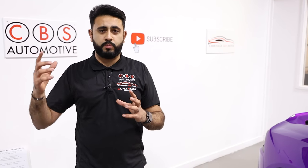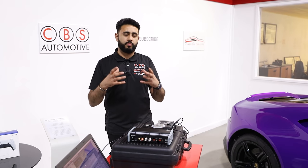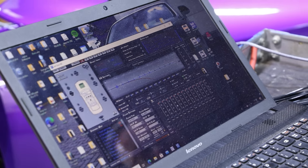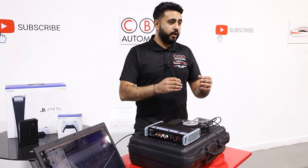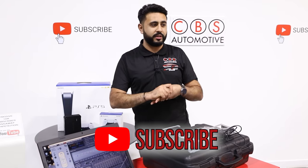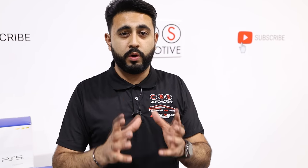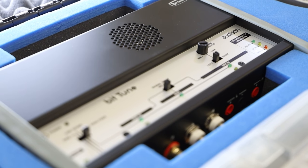That's why we always try to move the Audison Thesis tweeter on axis to the middle of the vehicle. This system is designed around the driver. Phase cancellation occurs when two speakers fire toward each other - elements of distortion enter the frequency range. We use software to control the sound waves and curves to eliminate or reduce phase cancellation as much as possible to get the best sound in the vehicle.